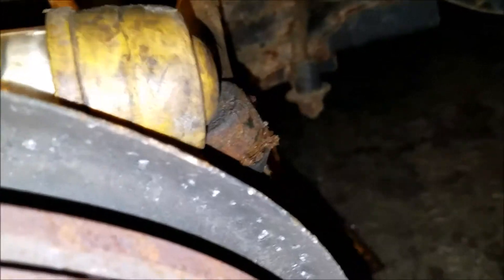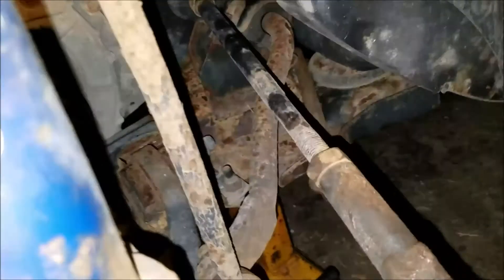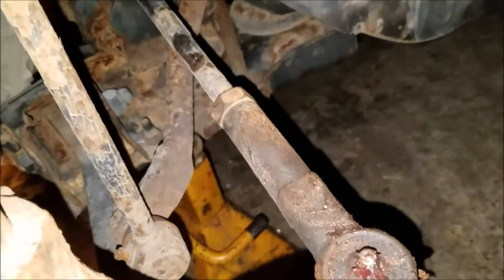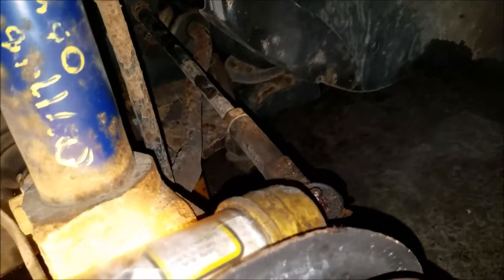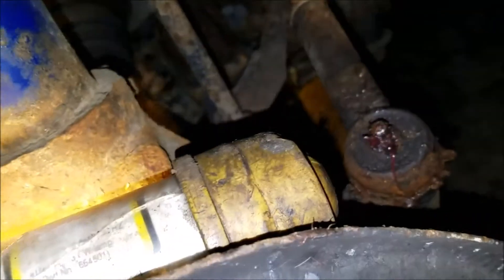You can see how badly that tie rod is worn. Unfortunately, a tie rod end costs about 20 bucks. You'll be able to loosen that nut up and screw the new tie rod end on, but depending on the manufacturer, you're gonna have to have it aligned — and that's about seventy dollars. So in the end it's gonna cost you about a hundred bucks to do a tie rod end.